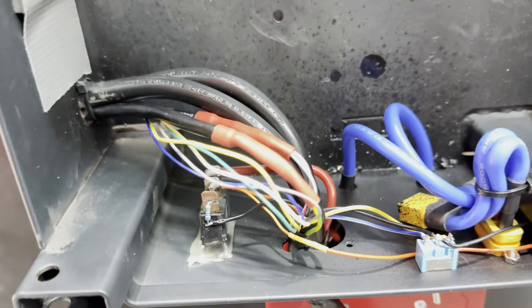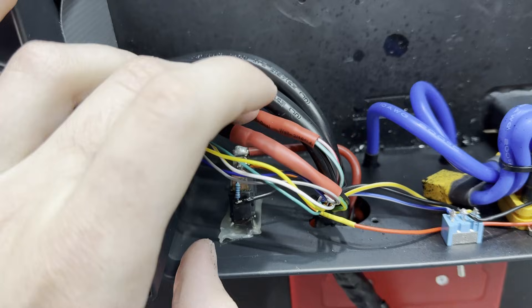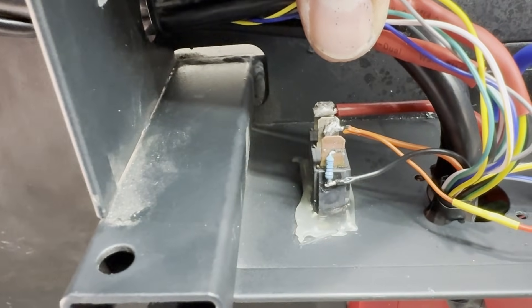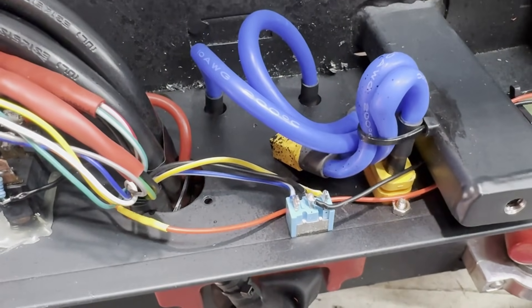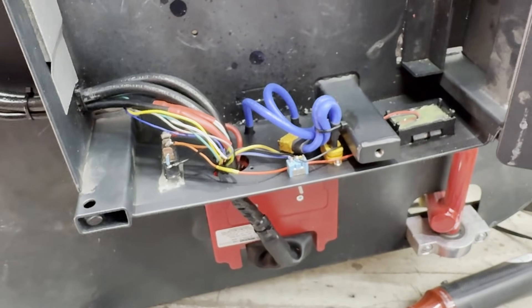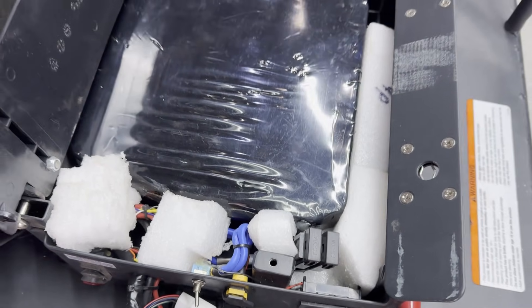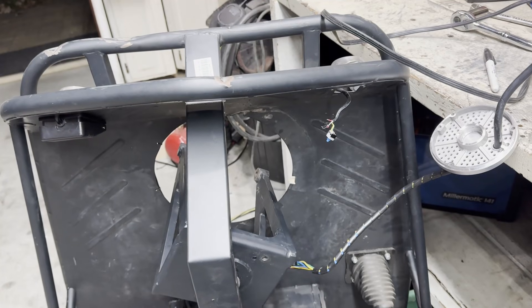The Far Driver harness was long enough to wire straight up to the ignition switch. I even managed to find the right resistor to make the ignition switch light work — I'll cover that with hot glue later so it doesn't wiggle loose. Same thing with the 3-speed switch. The voltmeter was the farthest away, but luckily it came with wires already attached so I didn't have to extend anything. After that, I put the battery in with a bunch of foam stopping it from moving around — it doesn't look the best but it's super easy to change.